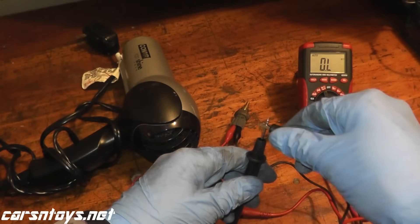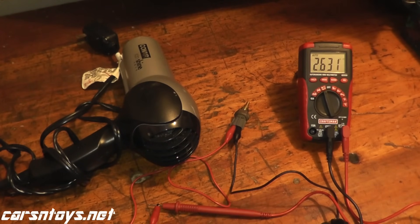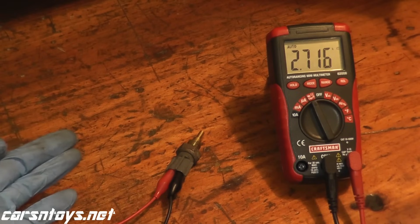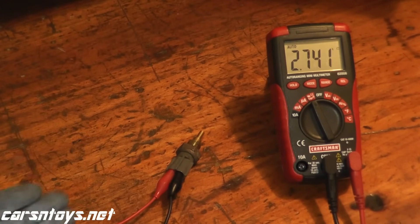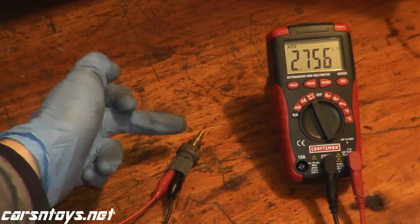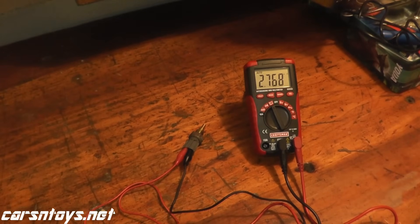We should see a reading. A good reading right off the bat would be around 2 kilo-ohms — around 2.6 kilo-ohms. So this sensor is in working condition right off the bat. You don't necessarily have to remove the sensor from the vehicle — you can simply hook up your multimeter to the sensor while it's still in the vehicle. This is a pretty good or average reading for a lot of vehicles, around 2 to 2.5 kilo-ohms, usually around 70 degrees Fahrenheit. In this garage it's around 50. So the lower the temperature, the higher the ohms reading, and vice versa. When we heat up this sensor with the hairdryer, we should see this decrease — this will just verify if the sensor is working correctly.